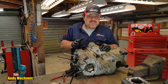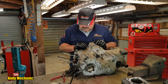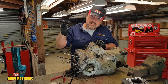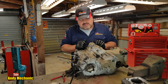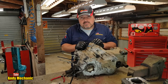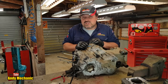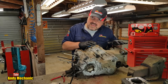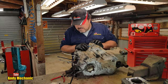Well, what else is left on the engine side before we get into the transmission? And it's a big transmission for a little quad bike. Well, we've got a crankshaft, and a crankshaft has a big end bearing. That's the conrod bearing that connects the conrod to the crankshaft, the web. And we've got main bearings. Possibly, it could be a big end failure, or it may well be a main bearing failure. Unlikely, but it could be. If those two are a pass, then it has to be something in the gearbox or possibly even the final drive. We'll find out. Okay, let's take a look at that big end.